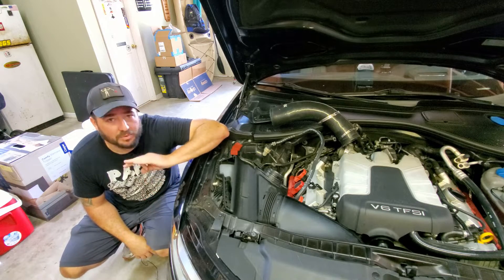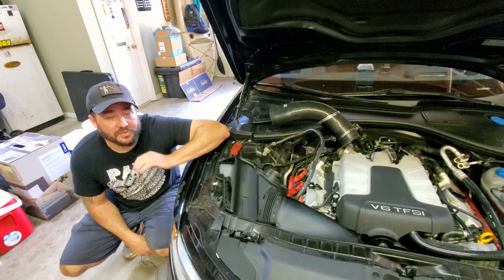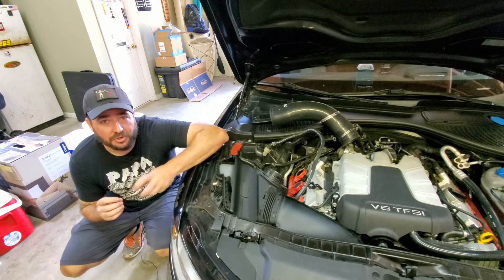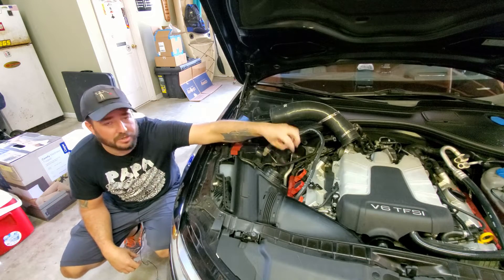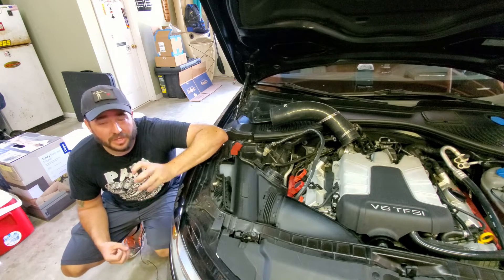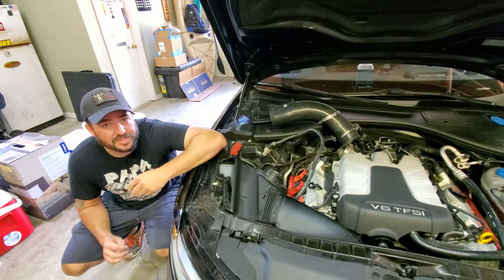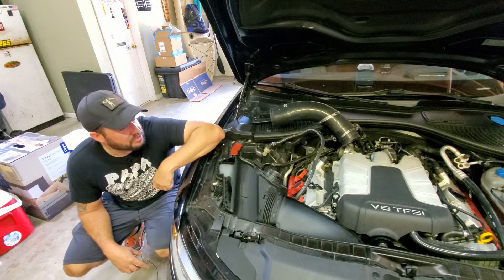Your third most common occurrence for a misfire, especially on cylinders three and six, is because of a leaking intercooler core inside your supercharger. Through multiple heat cycles of getting really hot and really cold, those start to deteriorate and leak coolant down through the intercooler core into your intake manifold, and that gets put into each of your cylinders in the combustion chamber. As liquid gets in there, it stops the engine from being able to properly combust the fuel and air and you'll get a misfire. That requires removing and disassembling the supercharger to replace those cores - so that's your biggest, most intensive replacement.